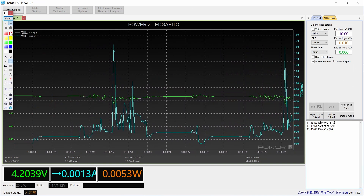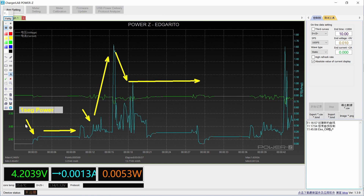The first thing is to start with the one-second rule. Remember I already showed you this. The one-second rule: at power-on you should see 60 milliamps, then the PMIC starts working, we have Apple logo, and then the CPU is on. Here on the graphic we need to have 60 to 120 milliamps in that first second, then BUCKS and LDOs, PMIC is on.